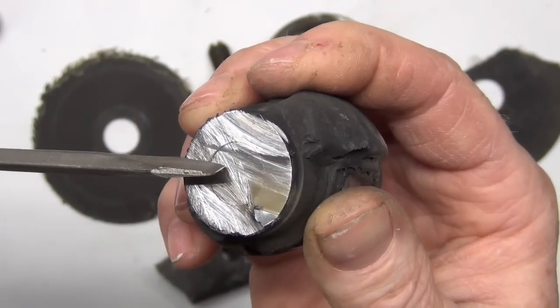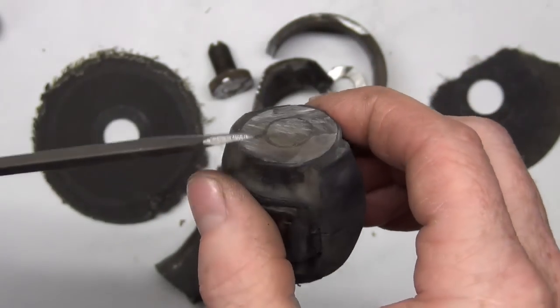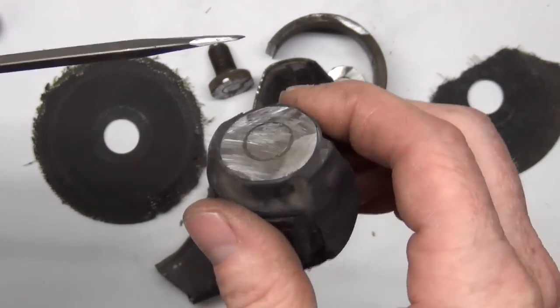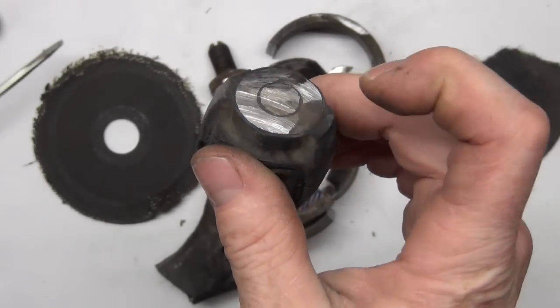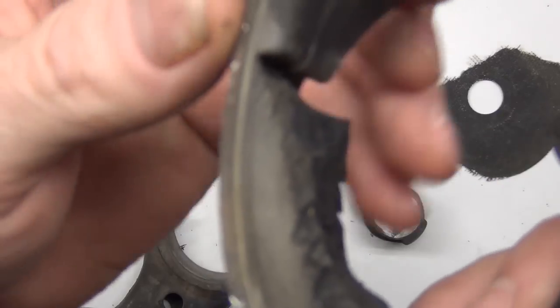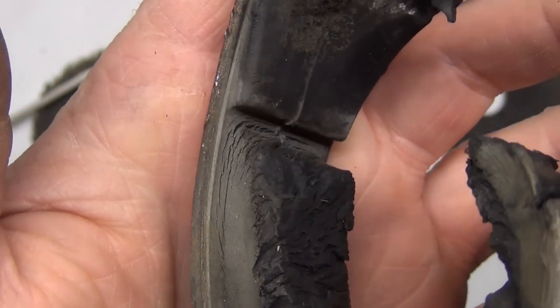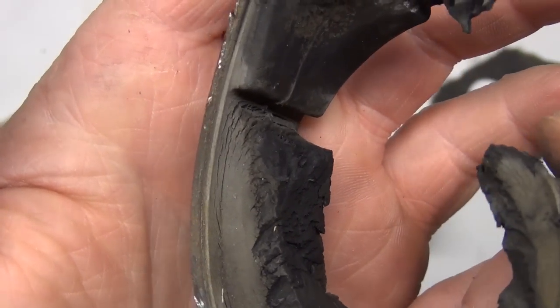A postmortem on the bolt and bushing shows very little rust at the bottom where the thing fell out. The top where the threads were reveals a significant amount of rust and impaction where this thing is just really, really tight. Looking at the rubber portion of the control arm bushing, you can see that there's a lot of surface cracking, which is indicative of drying, age, dry rot.